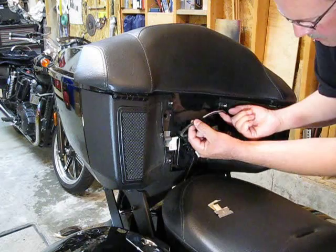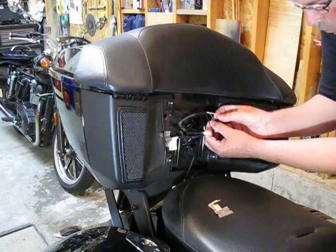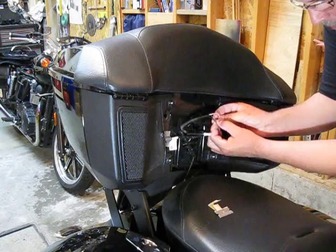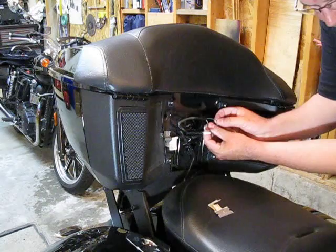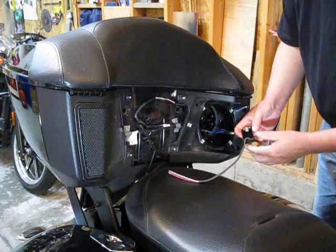I've cut out about three inches worth, revealing my three wires. Didn't take that long, actually. The white wire with the pink trim — that is our brake light. This is the wire we're going to cut in half, and we're going to splice in our module. The black wire, of course, is ground. And the green wire with the pink stripe — that is your tail light or running light.